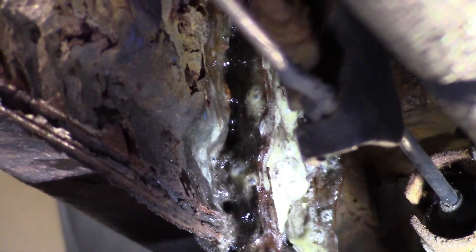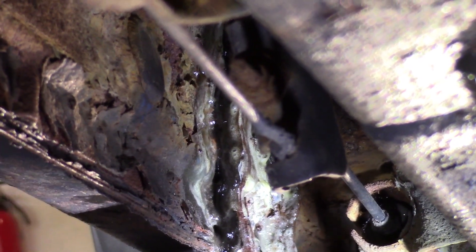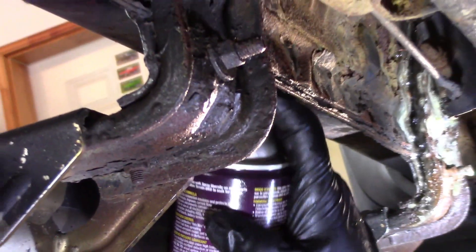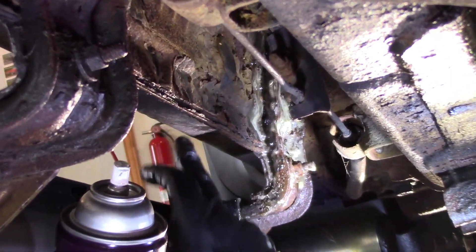If you're looking for one product that does everything, it's not going to do everything really well. Where there's not a lot of splash going up inside and it's protected from the steel — not a lot of snow and stuff going in — I'll use the thinner oil in there and I'll spray it all the way down, both sides. That way I'm getting to this problematic spot. You can see we're starting to break out on this side.